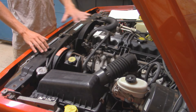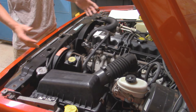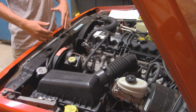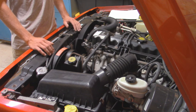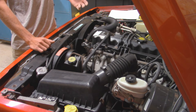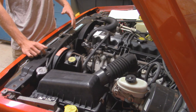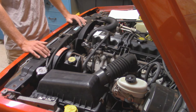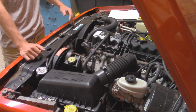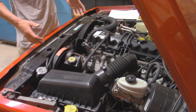Now that we know the basics, we're going to go more in depth on each component and I'll tell you what works best versus what are myths. Right here we have a factory-style two-row radiator, and it actually works the best. I did have a three-row radiator in one of my Jeeps — it does keep it cool, but once it reaches a threshold around 90 degrees out, it actually stays at 210 because the CFM going through the radiator can't keep up. Bigger capacity doesn't always mean faster cooling. So for these Jeep 4.0s and XJ Cherokees, it's actually best to run the factory setup — the engineers knew what they were doing.